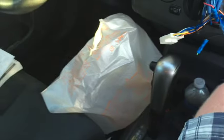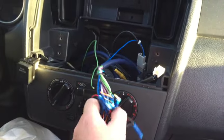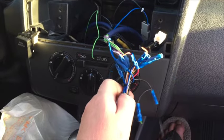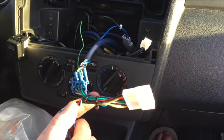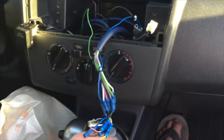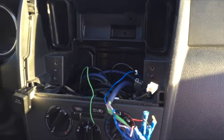Now for the wiring harness — I've already had an aftermarket stereo in here before, a Sony first-generation Bluetooth double-DIN touch screen, but I'm going Pioneer since it's a bit more Apple-friendly. I already have a wiring harness in this vehicle with two amps — a four-channel and a mono. Because of that I'm not going to use the factory speaker outputs; I'll cap those and use the pre-outs on the back of the stereo instead to run signal to the amps.